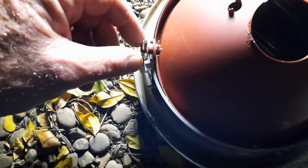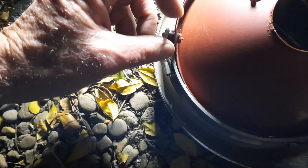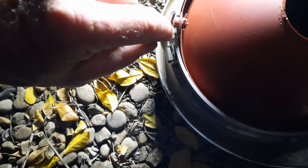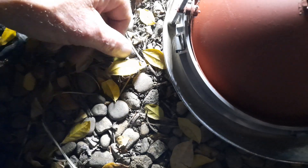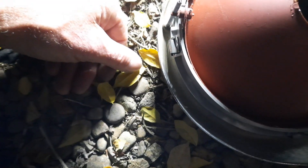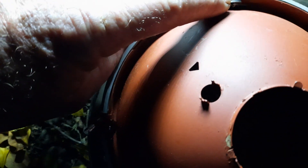These metal tabs plug into your headlight backing. If you turn them too far one way or the other they just pull out of the rubber, and because I'm doing this out on the road most of the time I've had to pull the headlight out, plug them back in, and start again. The other thing that was happening is this locator here was also pulling out.